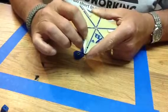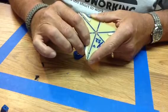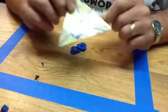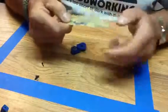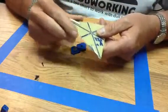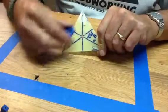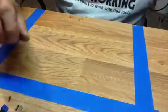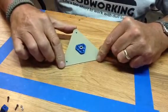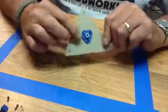Let's see, the Whippet recommends a 0.4 millimeter negative shim. I'm looking right at the plan as I read that. This already has one on it. This is 1/32 US fractional thickness plate from McMaster-Carr. After you get this all mounted up and put them aside, it's going to look like this. And here's one for another model that I've built. It doesn't have the shims or the holes on it. It's just ready to go. And this is what it's going to look like.